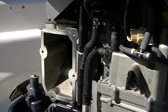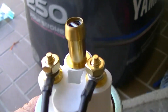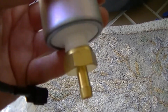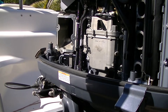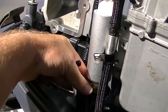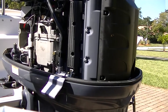We have the new fuel pump. I put the black side to that post and the red side to that post — they have nuts holding it down. I had to put the bottom part on, and there is a gasket — make sure that gets put inside there to keep the gas from leaking out. I'm starting by putting in the bottom part of the fuel line going into the intake of the low pressure fuel pump, then the top part, and then hooking up the electrical. After putting the clamp back on and connecting the wire, I'm taking a zip tie to attach it to the filter to keep it clean and out of the way.